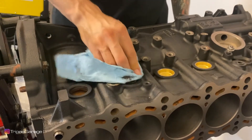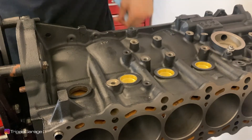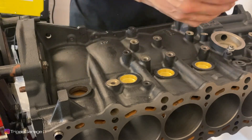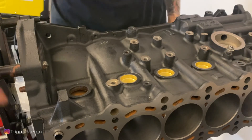There we are. Go ahead and clean it off and you've successfully installed that freeze plug into the block. You want to go ahead and just finish up all of them on both sides. Don't forget there is one in the very back of the block as well.